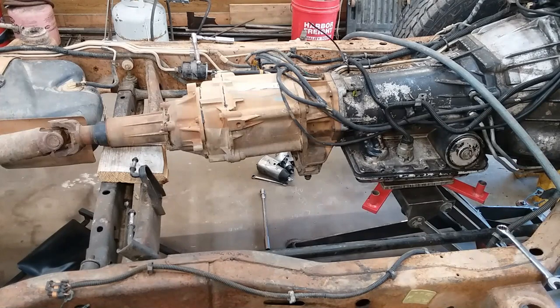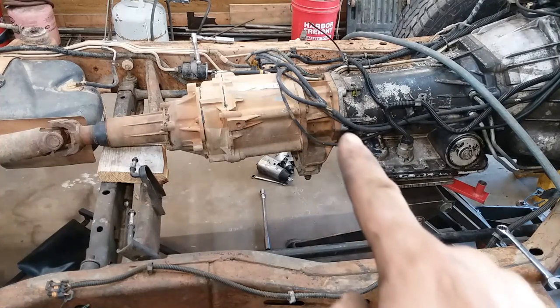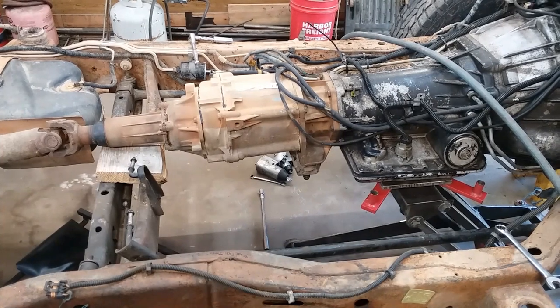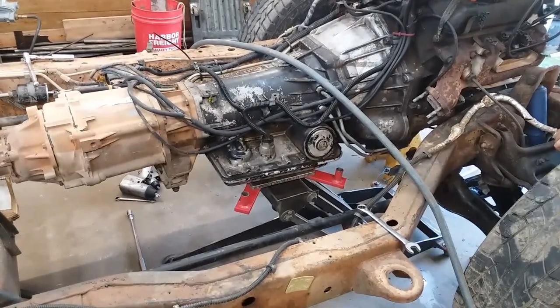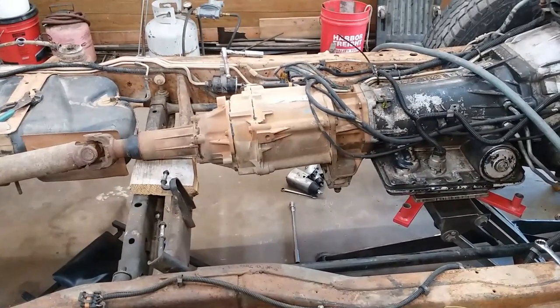It just makes my day go easier, because if I don't pull the crossmember out, chances are there's at least one hole along this line of bolts that is stripped out that I've got to helicoil, and then I've got to pull the crossmember out anyway. So since we've got to pull the starter out of this, our next step is to jack it up just a hair and yank our block out of the back of it.